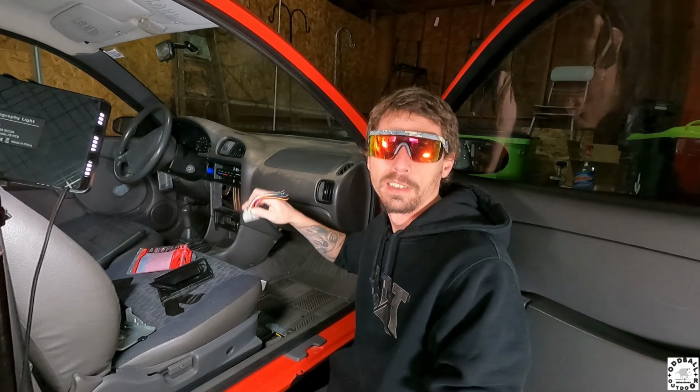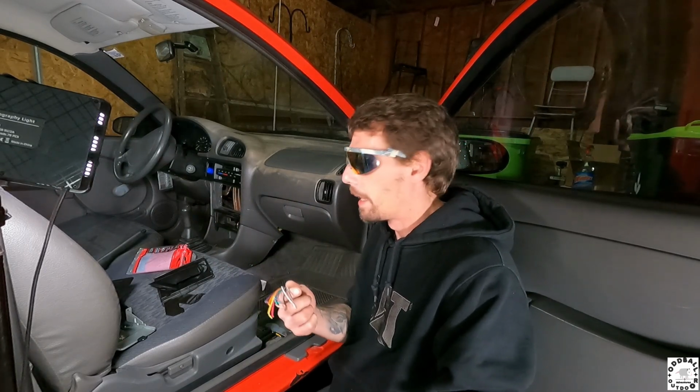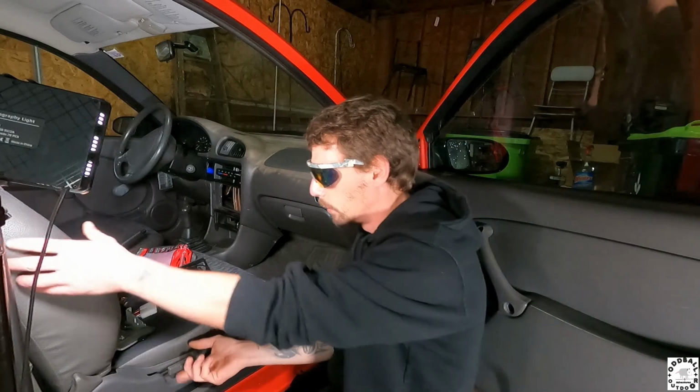This connects with the stock plug, and then I just gotta wire it up to the new plug that comes with the radio, instead of what I did in my first Geo, which I just went in the back like this, and I just snipped it off, and then I took the wires from the stereo and just kind of cobble it together. Now I can put it together the right way outside of the tiny little compartment of the under dash, and then plug it in, and then I got 4 speakers too.